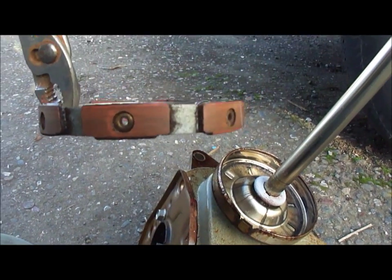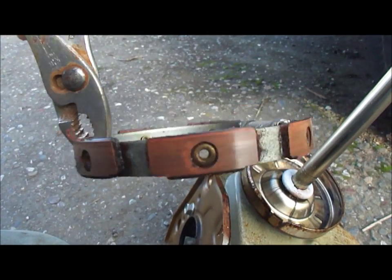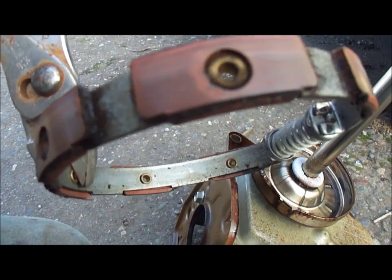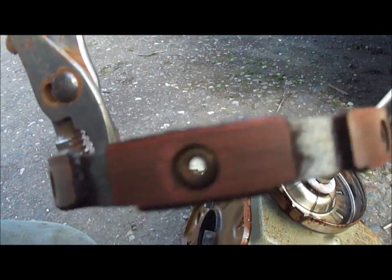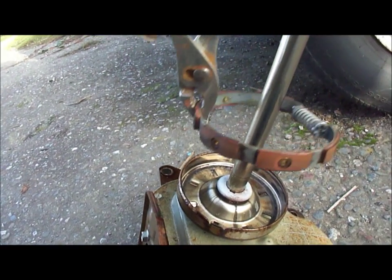The clutch goes down this way. You can see there are little feet on the bottom of the pad and no foot on the top. On the bottom of that pad there's a little foot right there, and on the top there's no foot at all. The foot always goes down because that's where it rubs.